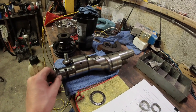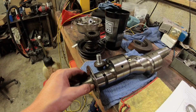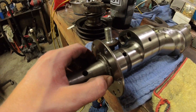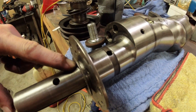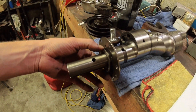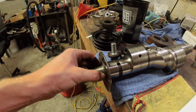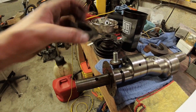In reverse to reassemble: put the washer on, put the spacer on, put the Torrington bearing on over the spacer, then bolt the plate down to the front of your engine. That leaves a little ledge — you're going to put the next Torrington bearing on. It is very, very important that this Torrington bearing gets on top of that spacer. If you put it on wrong and torque it down to 58 ft-lbs, you're going to ruin that Torrington bearing and lose all end play.